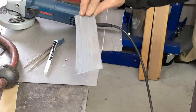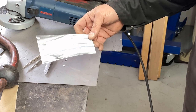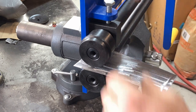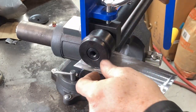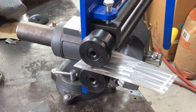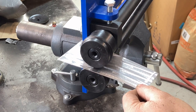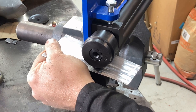It was easier to grind off the mill scale and prep the patch now, so I had to re-scribe and outline the bead-rolled profile again — no biggie. Let's head over to the bead roller. Nothing fancy here — your cheap Princess Auto/Harbor Freight bead roller. Panel set in on line with my mark, tension the bead roll die down onto the panel. Don't want to overstress it; it's not the most robust piece of equipment. Go in multiple passes, take it slow, crank the wheel — not motorized, for the amount I use it. This is the second piece I've ever bead-rolled, so I'm learning as I go.